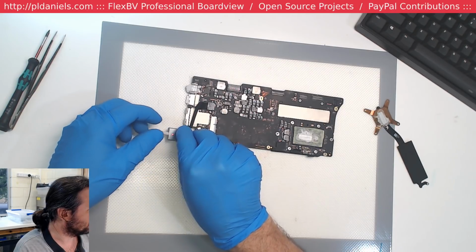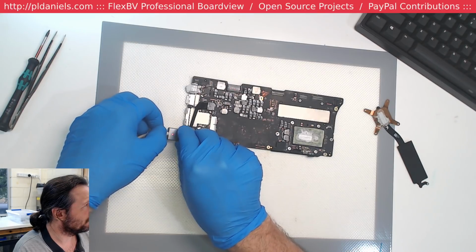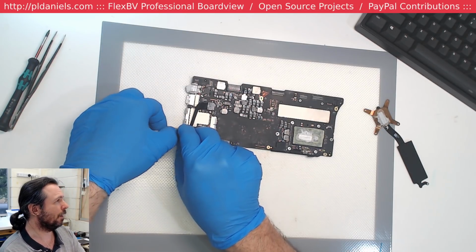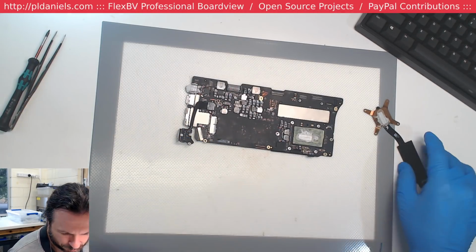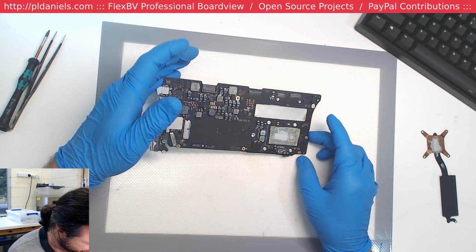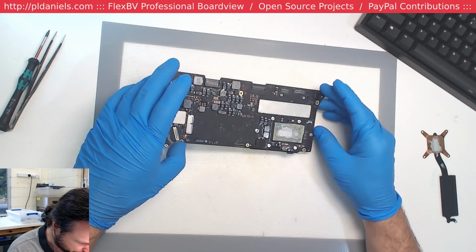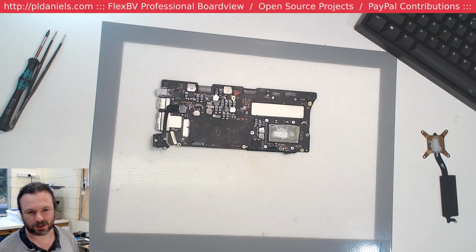10, 17, 50... Unfortunately, the power supply does not react quickly enough for me to see if there's a genuine high current transient. You really need a much faster sample rate to see if you've got something that's happening within a millisecond, whereas the visual update on the power supply is probably more like 10 times a second, so every 100 milliseconds. It's not fast enough. It could be dead CPU for all we know.